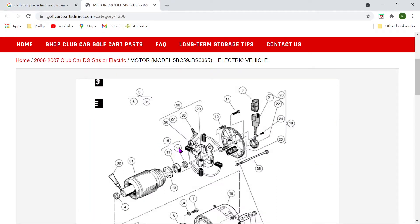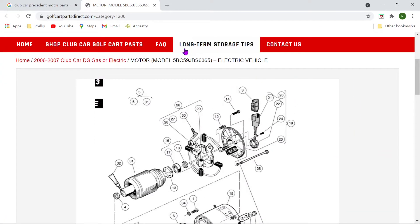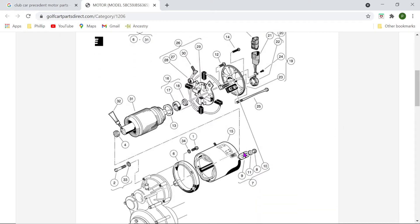I found the breakdown for my motor. This is my motor — whatever this model number is here — and this happens to be online at Golf Cart Parts Direct. The motor part number was actually on the label on the motor itself, so I was positive this is what I had. When I went to take my motor off, I did it just like all the other videos showed: take the bolts off, this bolt on the bottom, take your wires loose, grab your motor, rock it back and forth and just slide it right back. It said when you get ready to put your motor back in, make sure you apply anti-seize lubricant to the spline, because if you don't, the next time you go to take the motor off it might be stuck and the only alternative is to beat it off.